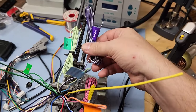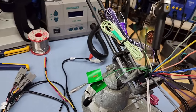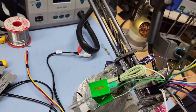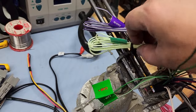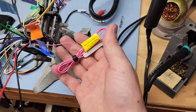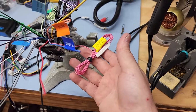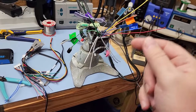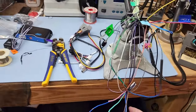We have a reverse wire and a parking switch. The parking switch is interesting - you're supposed to run it to the parking brake so you can access certain features of the radio. It's a legal requirement, but most people just run this to ground so you can access those features whenever you want. There's also a speed sensor wire - I believe this allows the radio to control its volume automatically with the speed of the vehicle. We're going to strip these guys, match them line for line, solder them, shrink tube them, and have a matched wiring harness.